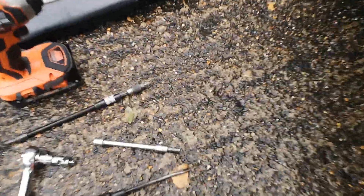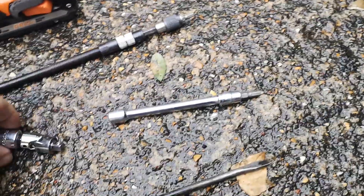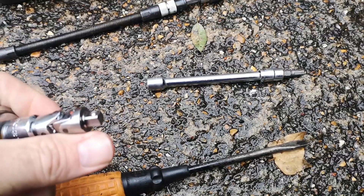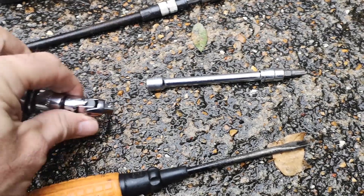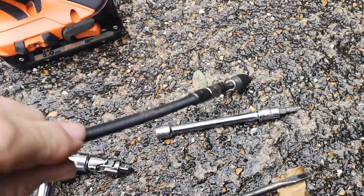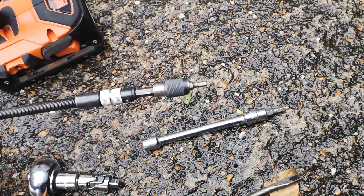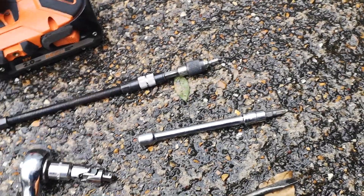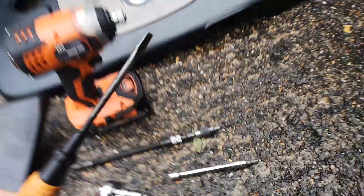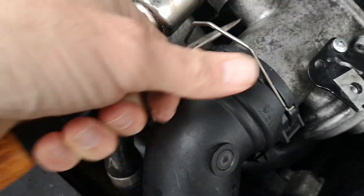Tools for the job: a five mil cap head with a small extension. I've also got a little flexi joint to help me get to that bottom cap head. There's also a plan B — one of these with a bit more flex. You can use a five mil socket end to get that cap head out, and a flat end screwdriver for the screw.